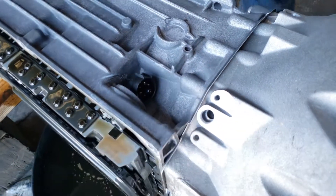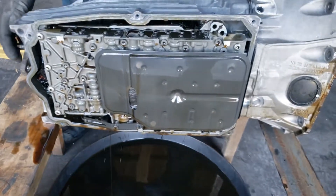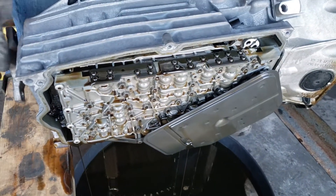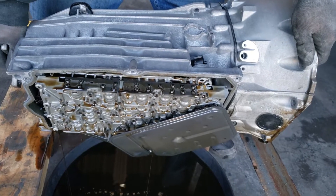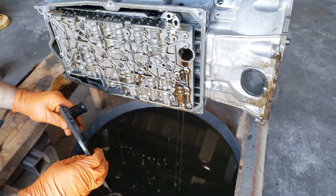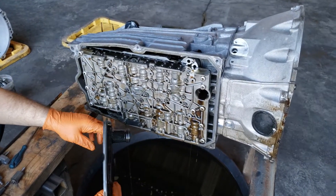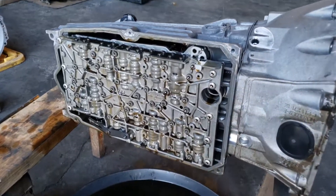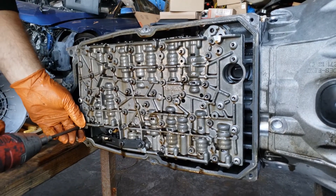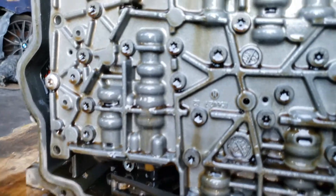Make sure you unplug the conductor plate plug. So this is going to be your oil filter, this is your valve body, and that's your conductor plate inside. To get to the conductor plate you do have to remove the valve body completely. The oil filter slides out — it's pretty easy — just make sure you have a good oil pan ready because it's pretty messy. We're going to be using a T30 Torx.